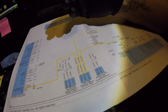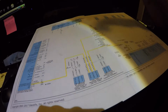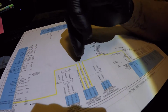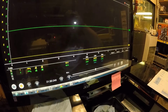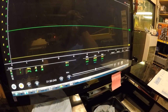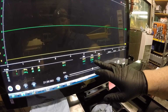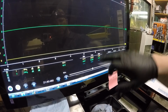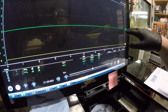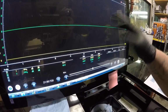A lot of older vehicles, they didn't have that. So all it was a standalone signal wire, and all it did was send a signal back. So if it was unplugged, that wire would read nothing. It would read 0. I don't want to say older style system, because it's not really older, there's a lot of cars that still use it today. But when you unplugged it, the yellow wire, which is our 5-volt signal, would go up to 5 volts. The green wire would drop down to absolutely nothing. It would just read absolutely open, no voltage, no ground, nothing. So it would just read 0.